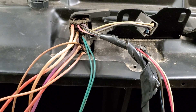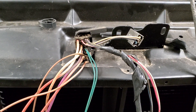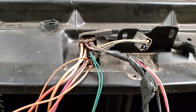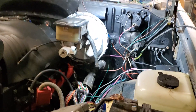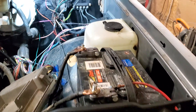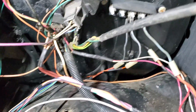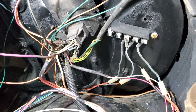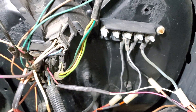So you won't be pushing your LS swap truck around! Guys, I hope this explains it a little bit — that's how I'm running mine. It's not hard to do. Let me show you real quick how I've got this done. I've got a main hot wire running from the battery up to that junction block right there. You'll see it's got a bunch of wires off of it — all fusible links — and everything runs over to the bulkhead. I'll clean all these wires up, but that's how it works.